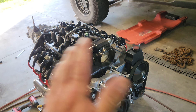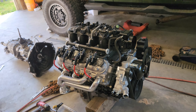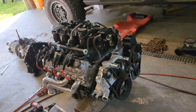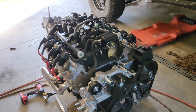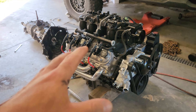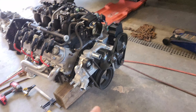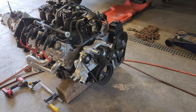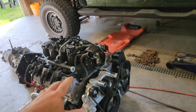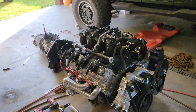I've had several people ask me what all has been done to it. It looks really nice. Technically, this is basically a stock LS that's had a few bolt-ons. The biggest thing I did was 799 heads. They come with the factory 317 heads — it's a very low compression motor, 9.4 to 1. I wanted to bring a little more horsepower up without forced induction, so I put 799 heads. It now has 10.5 to 1 compression ratio, which is definitely going to add a lot more power.